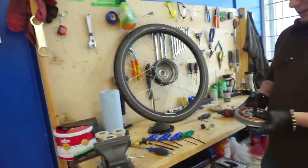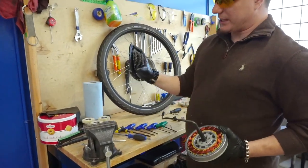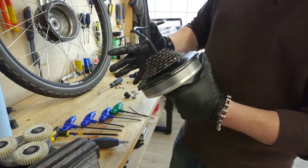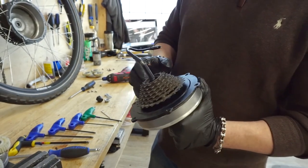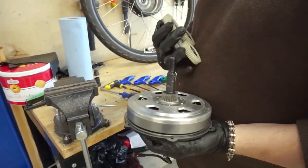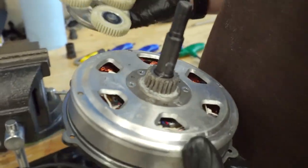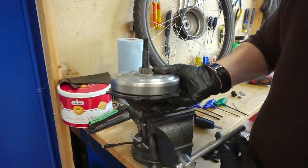We're going to take our new motor and put our existing motor plate and freewheel assembly over the drive wire — that just slides on, no tools necessary. Make sure it's spinning freely with no bearing noise. Then flip the motor over so the planetary gear goes down to mesh with the pinion gear on the inside. You're going to want to line up that groove with the key.